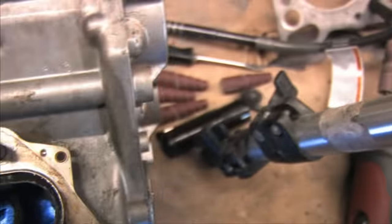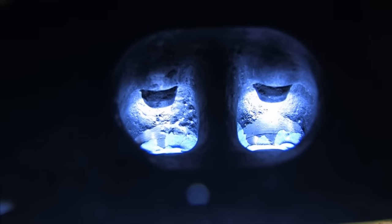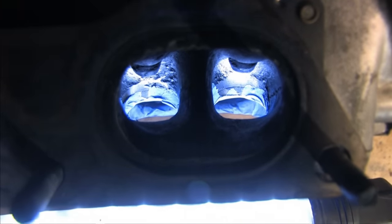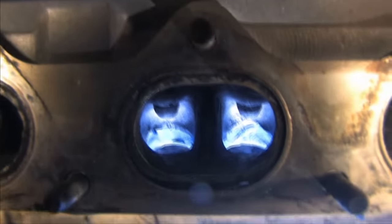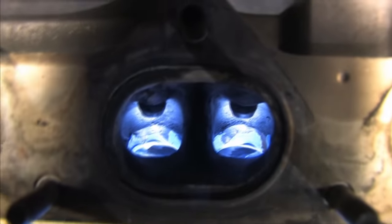Make sure your dust mask is up to snuff. The transition from the seats is really rough and uneven. If I installed a larger turbo than what I have on here right now, there's just no way that these tiny little exhaust ports could keep up with the demand. The one advantage to these exhaust ports being so small is that the escaping gases leave the head with lots of velocity, great for spooling a turbo.